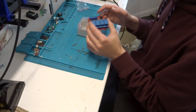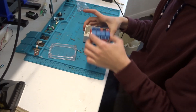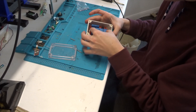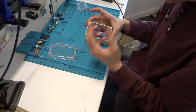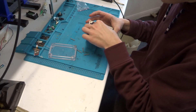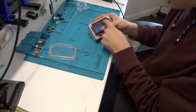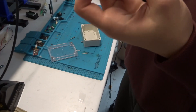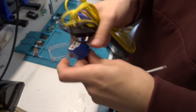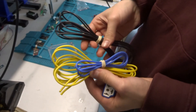This is a set of four relays which will be for high beam, low beam, left indicator, and right indicator. The plan is for this to go here and as you can see there's not a lot of room, but the signal connectors won't take up space so I can push it over to that side. Then we've got a fair amount of room for the 16-gauge wires to come out. For the headlight, it came with this adapter which I cut in half.